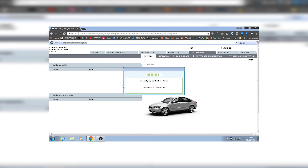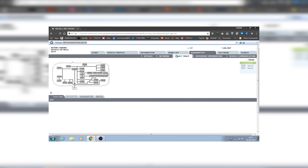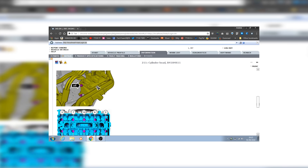The diagnostic software for this car is Volvo's Vida system, which is pretty interesting. It allows you to see every detail about your car and do fault tracing — for example, I have a slight error in my accelerator pedal, and you can see that exact issue. You can also see things like a lock problem my car flags, which it doesn't actually have, but it gives very precise information about where the problem is, what it is, and how it manifests. Vida also includes repair manual-type content, so if you want to find out how to replace your accelerator pedal or remove your engine cylinder head, that's all in there.